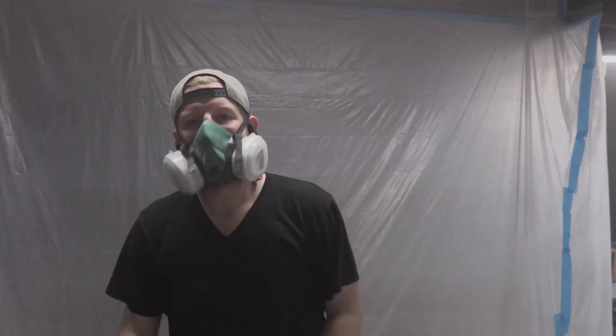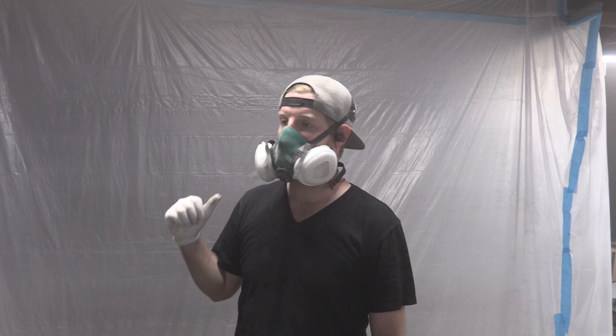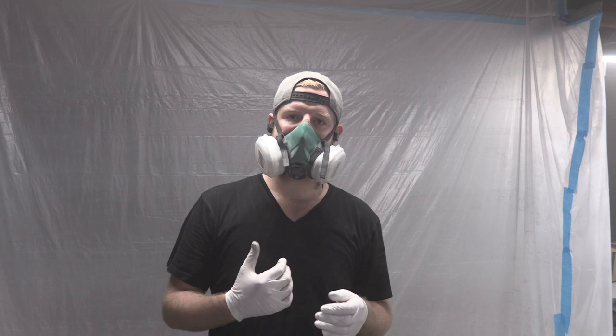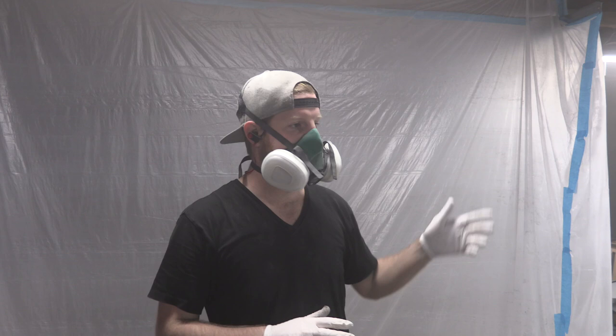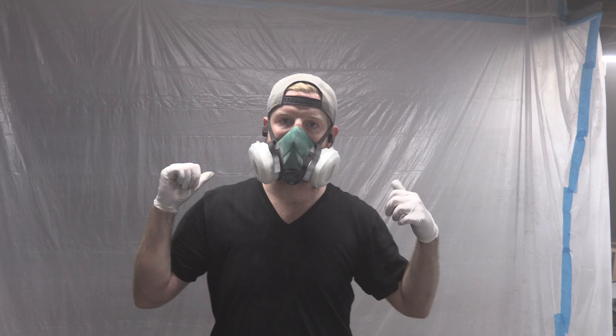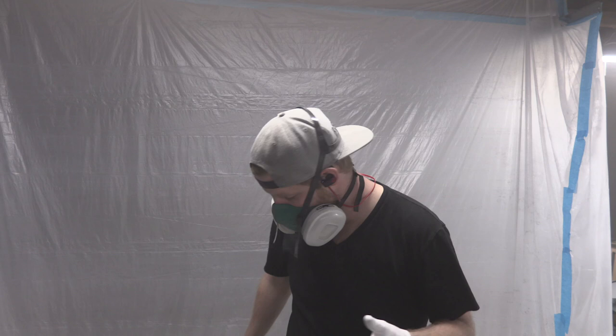We are done. It's midnight, which I call quitting time, and we just finished painting. I think we are on track to have the best paint job I've ever done. One interesting thing — when we switched over to clear, the gun started getting gummed up, the fluid wasn't going through. I think the cup was contaminated, so I switched cups and didn't have that problem anymore. The Euro Pro T from Astro Pneumatic worked like a charm — great gun. It really just needed the boost in air pressure, which this tank was able to give me. The results are way better. The cube is kind of working — not 100%, but keeping the majority of overspray inside. The one big mistake: we need ventilation. There's no ventilation in there, it got pretty bad and I couldn't see what I was doing. We also need more lighting. But all that being said, I think that is going to be the best paint job I've ever done once we wet sand and buff it out.